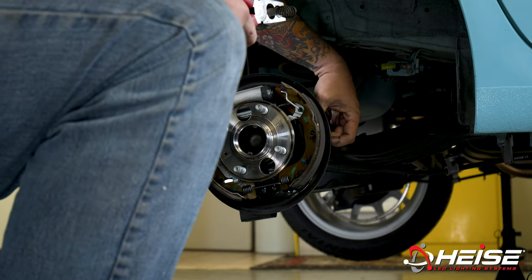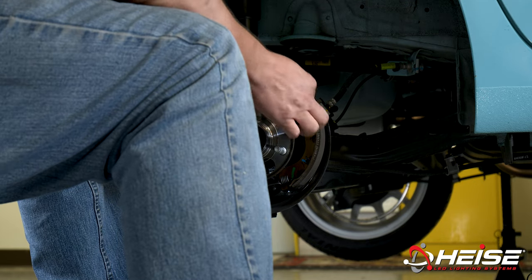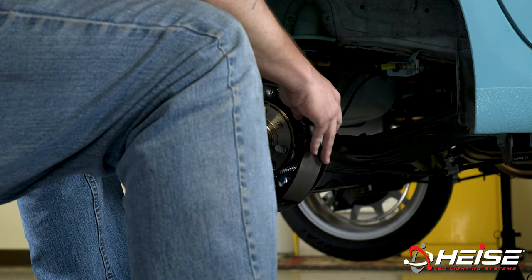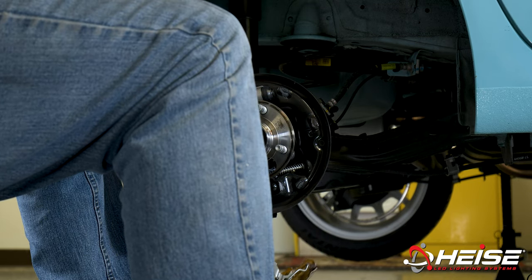Carefully open the brake shoes and remove the return spring closest to the anchor point of the shoes. Leaving the parking brake lever connected, drop the brake shoe out of the working area. Then place the trailing shoe in a clean area where the lining isn't touching.